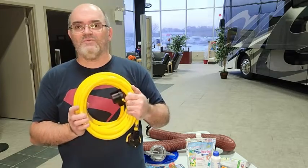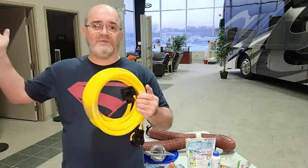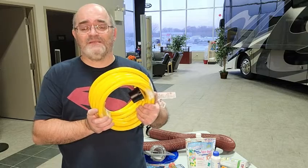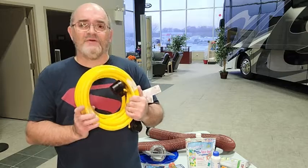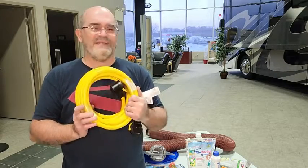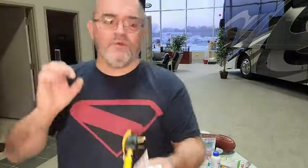A typical cord on a trailer is going to be somewhere from fifteen to twenty-five feet, most about fifteen to twenty feet. You can get twenty-five to fifty foot extension cords. Now if you have a 50 amp unit and want to save money on an extension cord, get a 30 amp extension cord and step the unit down when you need to use it — because likely you're not going to want to draw 50 amps at a provincial campground. In some places they only have 30 or 15 amp service anyway. The downside of 50 amp cords: they're really bulky because they're much much thicker.